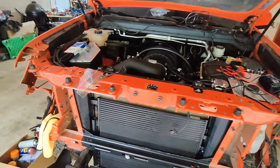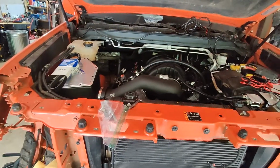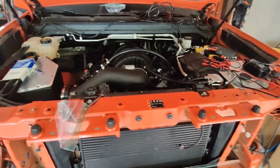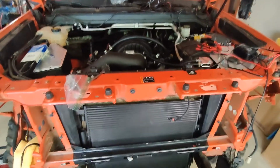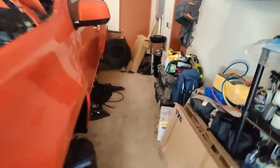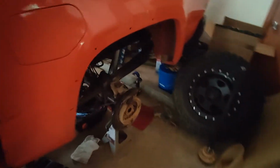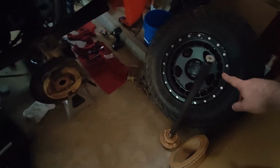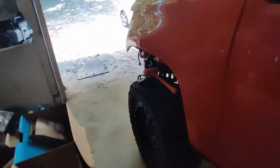because I've been hearing sometimes even with the AC off, it can engage the clutch, and I don't have any oil at all in the AC system right now, so if that clutch engages, that compressor will be running dry, and I really don't want to do that. Also, while I'm waiting, I decided to start my regear. So, as you can see here, I have the axles pulled. Started pulling the carrier. Let's go around to the other side.